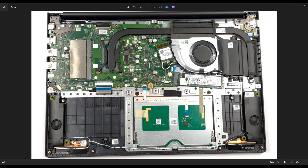This is your LCD cable up here coming in from the hinge assembly. There's a sticker here with a label on it — you would gently peel that sticker up, but don't rip it off as you could damage your cable. After you get that up, you should be able to push the cable up out of that port.